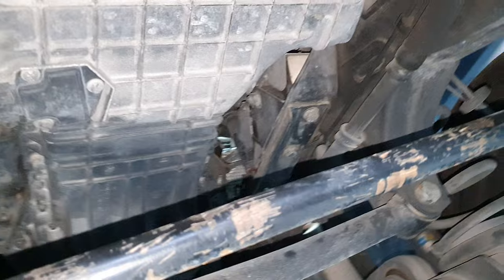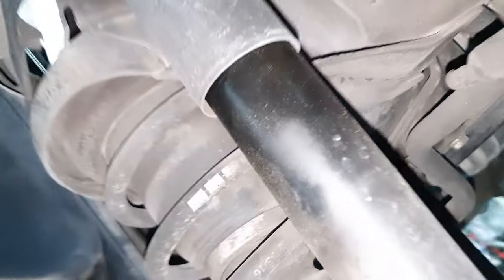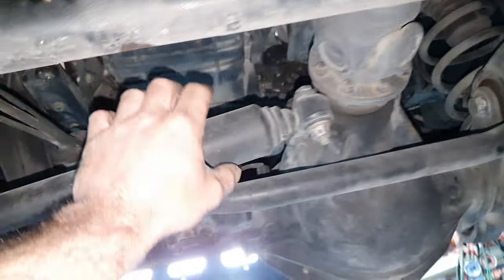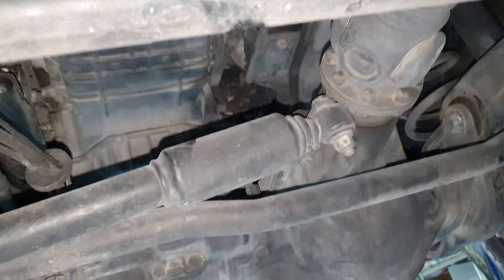All right, nice, clean. Only one shock absorber here, it's leaking. It's a little bit wet here at this point. Usually you change pairs, you're not changing only one. If you change the two shock absorbers and this one, you're gonna see much more improvement on the steering, on how it's steering the car.